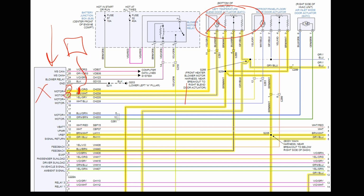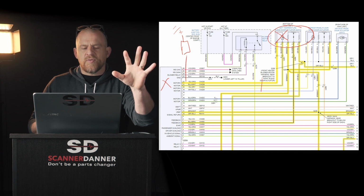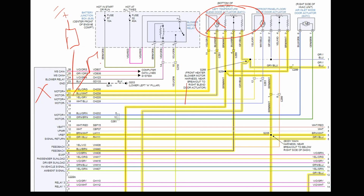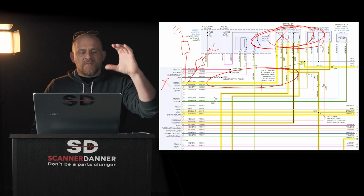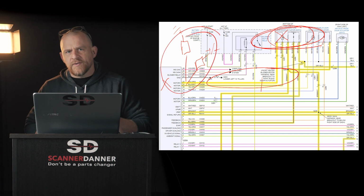And so if we didn't see motor amperage changes there, then the next step I would have done is the test light test that I mentioned to you guys earlier, switching my polarity with my test light, moving the motor hot and cold, and making sure my test light lights on both polarities on both wires up at the control panel. And if I saw that, then the only thing left is wiring in between or the actuator itself, and you're pulling the dash apart anyway. So that last part, we should have covered that. We did not. That's why we brought you guys here to the studio.